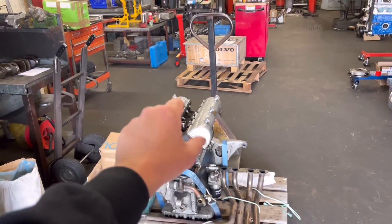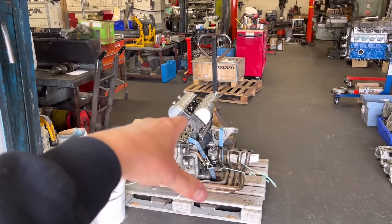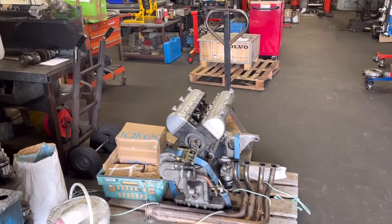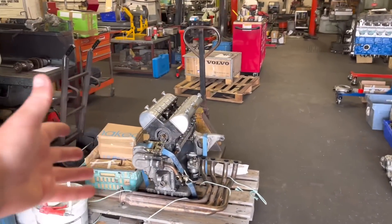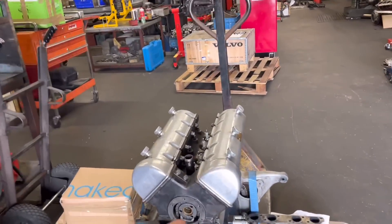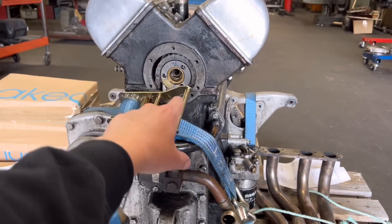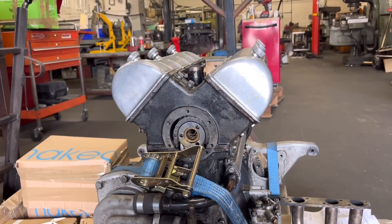Right guys, so we've just had this engine turn up - this is the second one we've seen certainly since I've been here. This is a Lagonda Rapier engine. As you can see, I think this is a 1936 or something like that, so it's real old - getting on 90 years old. When you actually have a look at it, it's a real advanced bit of kit for its time. You've got twin overhead cam there, you've got chain driven. So when you actually look at this, not a lot's changed these days - they still use a chain driven. In here you've got a sprocket, the cams are driven by this centre sprocket which is sort of driven down from the crank. So yes, similar sort of setup really to modern engines.